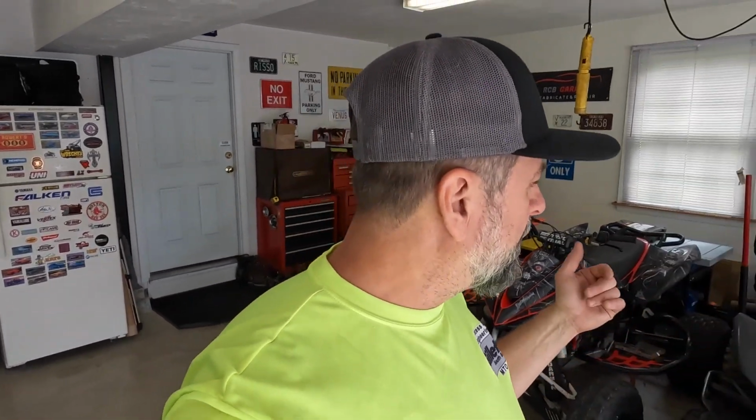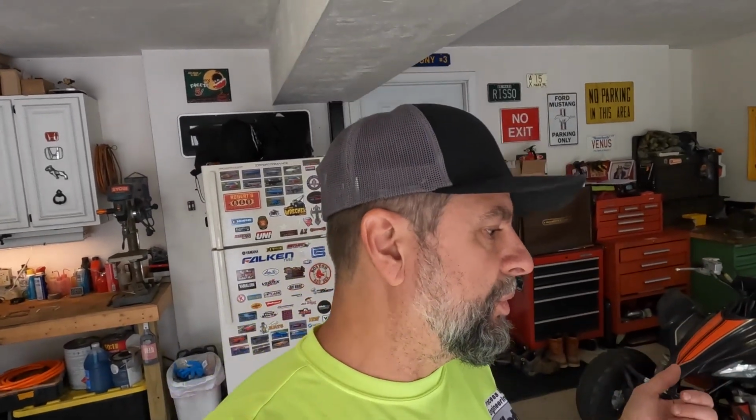And you know what? I took the side cover off this as well, and the side cover gasket didn't fit. I had to buy another one. So I don't even think that gasket set was even for this bike. I think it was mislabeled on eBay, or they shipped me the wrong one. I don't know. But that was my problem. So I don't know how the oil was getting in the motor. It was either through the valve seals, or head gasket, or base gasket. Anyway, I replaced every gasket in the motor and the valve seals, and problem solved.